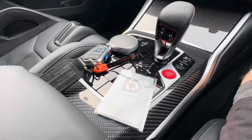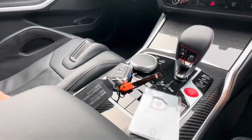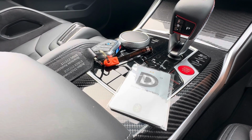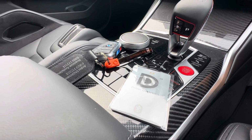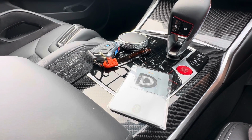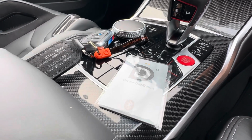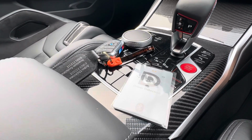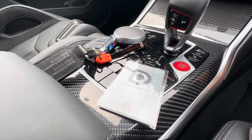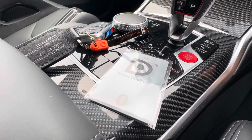With S7 tracking solutions, the 24/7 monitoring centre monitors the vehicle for movement without ignition, i.e. tow-away theft, or battery disconnect. S5 covers movement without ignition and battery disconnect, and also driver recognition. So if the vehicle moves, even with a valid key or a cloned key, and the card isn't present, the control centre will get an alert. They will alert the registered keeper to ensure that it's being driven by an authorised person.